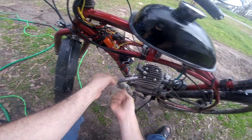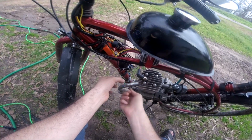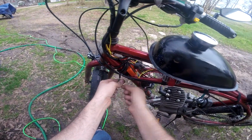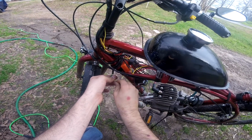You twist your wires for two reasons. One, obviously it helps prevent them from fraying as you're working on components. And two, it helps remove air pockets so the solder can engulf the wire more freely.